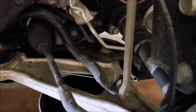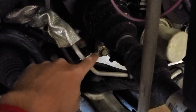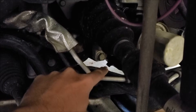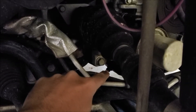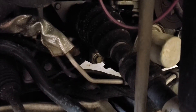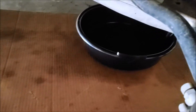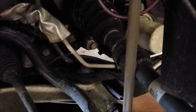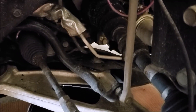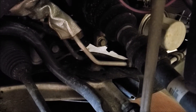Okay, so the cap's off up top. If you look in here — kind of hard to see — that black little blob there is your oil drain plug. It's a 14-millimeter bolt; crank it lefty-loosey. Get your oil pan ready and some cardboard in case you miss. You can see by the looks of the cardboard I've missed a few times with the Mustang, but this car only has half the amount of oil so hopefully it's not as big a mess.